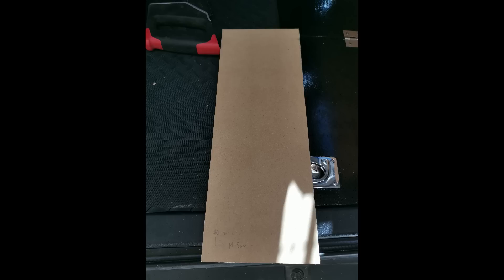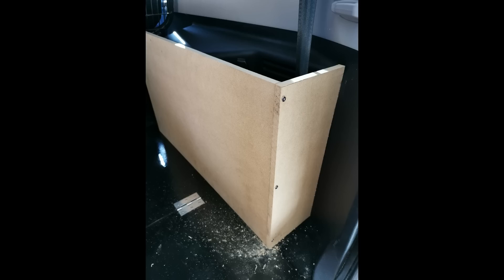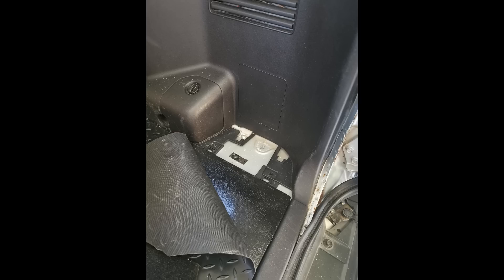40 by 14.5. Anyway, that's the two pieces just mocked up, just sitting there, getting some ideas. I'm going to glue and screw it, so I've got some timber screws — I used these ones and a combination of about 10mm ones as well. I just punched some holes with a drill — I think it was a 3mm or 4mm drill bit before screwing in. That's pretty important so you don't split the MDF.